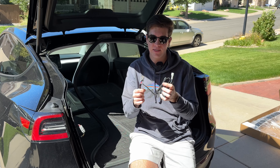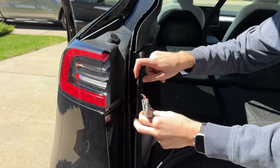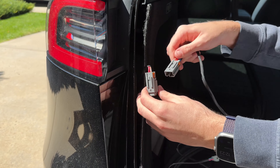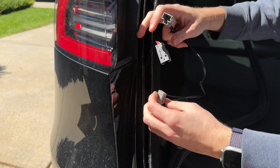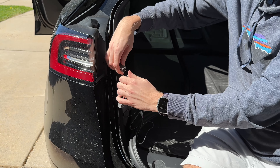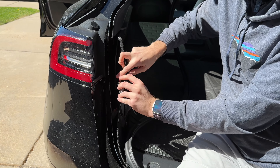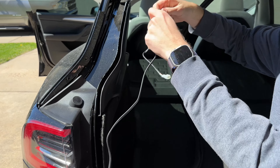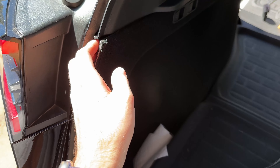For the first step I'm going to use this pigtail connector. In the back of the trunk of the Model Y, the 12-volt outlet has a connector right here — and these are basically the exact same. You're supposed to unplug this and then plug it back into here, and then plug right here, pigtail connecting it all together. Then you push that back inside. This is the wire that I'll be feeding all the way up through here and through the headliner.